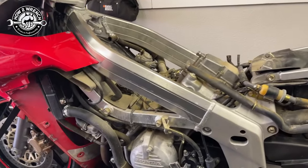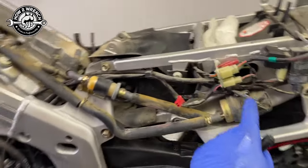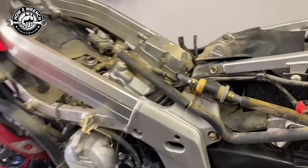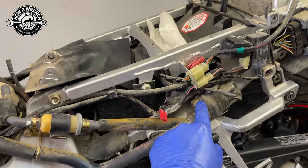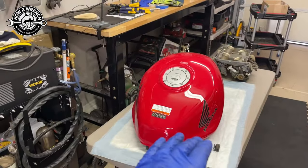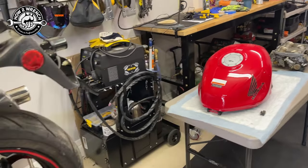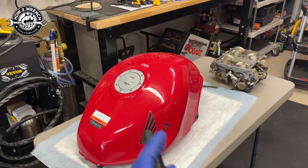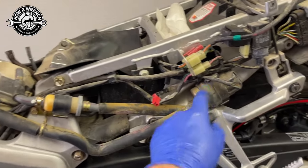So it's going to tell us a couple things to think about. Number one: the fuel tank sits up here but goes to a fuel pump. That fuel pump is lower than the carburetors, and the fuel line comes up pretty high above where the bowls would be. There's a possibility that the valve in this fuel pump that shuts it off when sitting could be bad. What I want to do is go inside that tank and see what the fuel level is — see if it's down. There's a chance it's bypassing, which might mean I want to consider changing that pump.